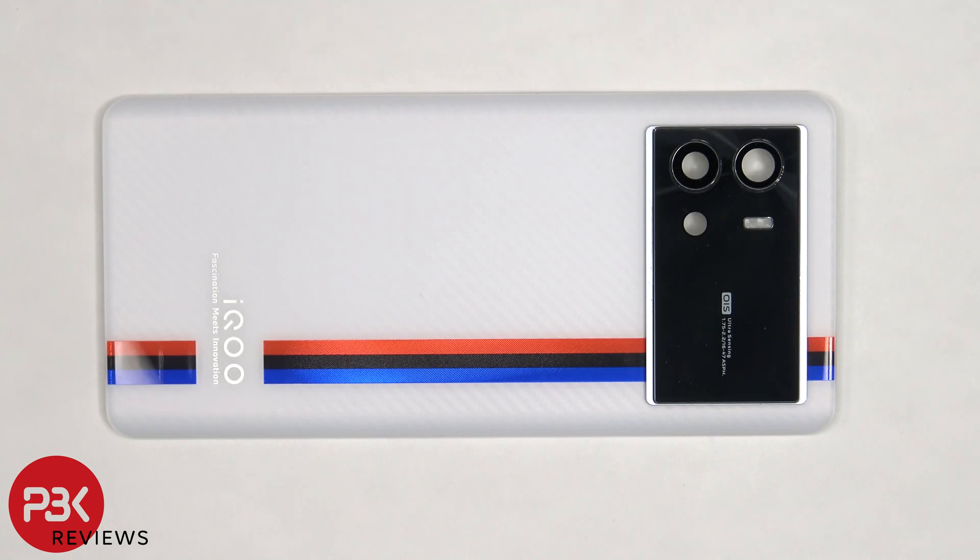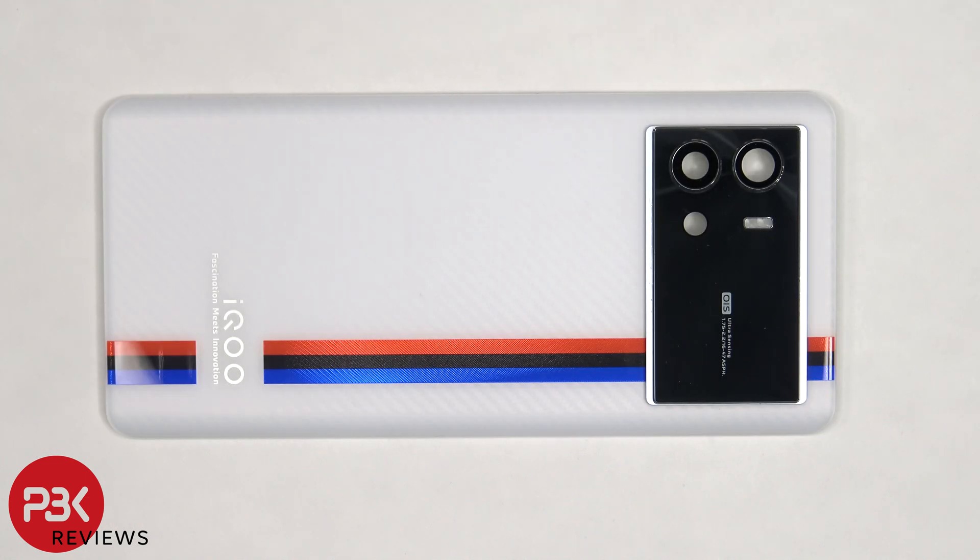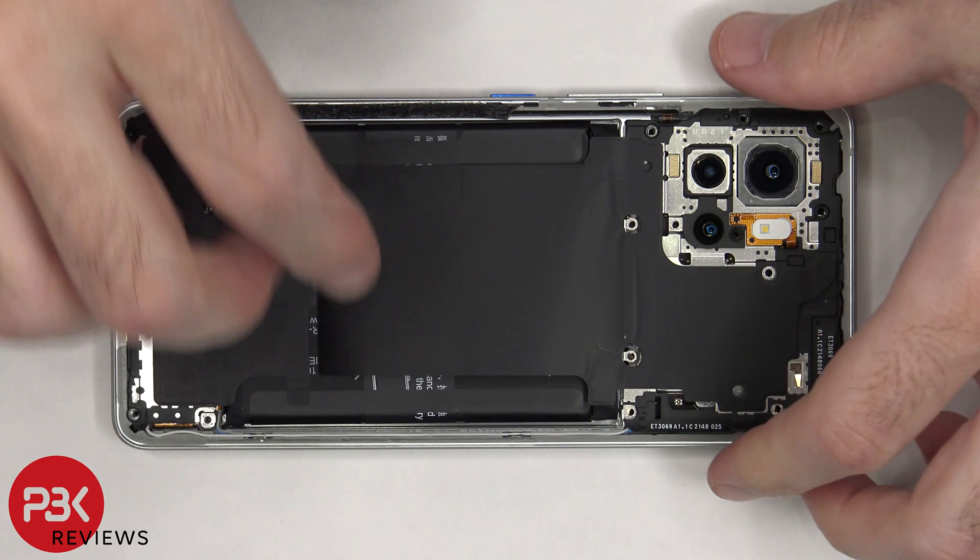So this way it'll help transfer heat more efficiently. The glass covers can be replaced by applying heat and gently prying them off. There are 20 Phillips screws that need to be removed. Now the top cover can be lifted up and removed.